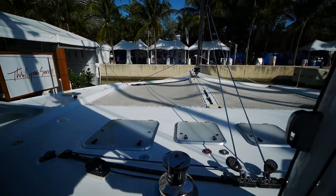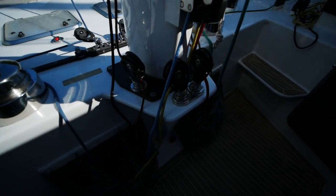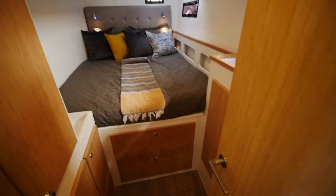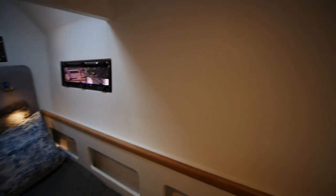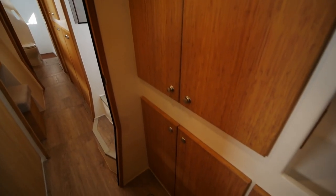It's got about six and a half feet of clearance to the boom. It's like a Gunboat or H&H or some other Morelli and Melvin designs. Making our way into the port hull, we've got a nice big closet here. The hulls are nice and narrow, and this boat is very light displacement. You can't have an electric boat that's heavy displacement — things really have got to be efficient or you'll just be stuck running the generator all the time.